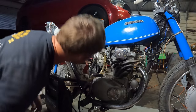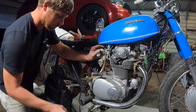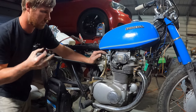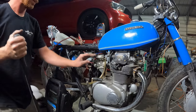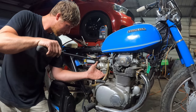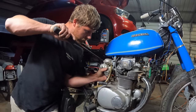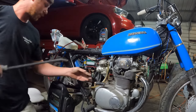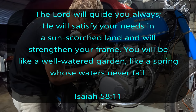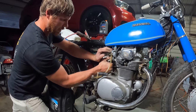The side that I did not want to go in first is the side that wants to go in first. Can't get down. I may have to get a heat gun and heat these boots. They're as hard as a rock. Usually when you get them started, they'll go the rest of the way, but not this one. Race bike was not this bad.